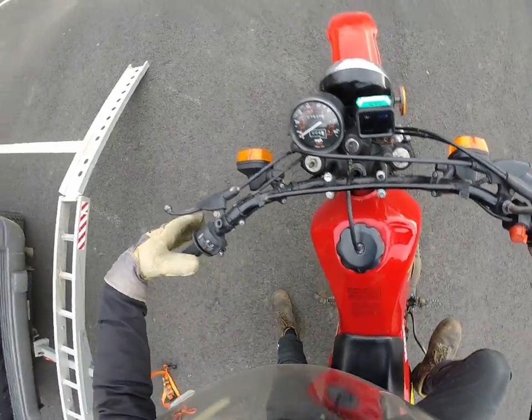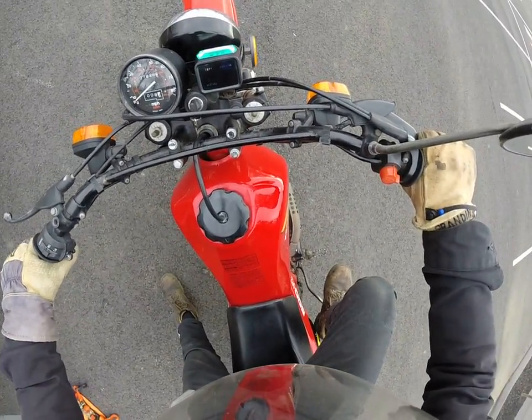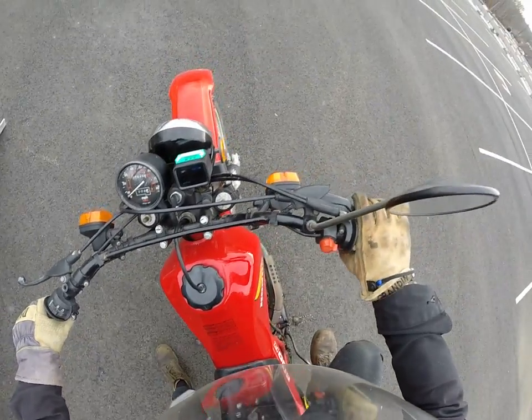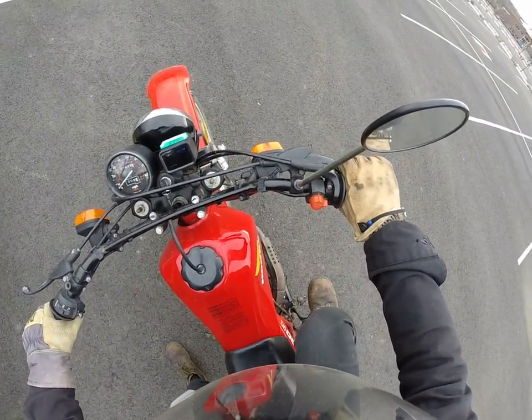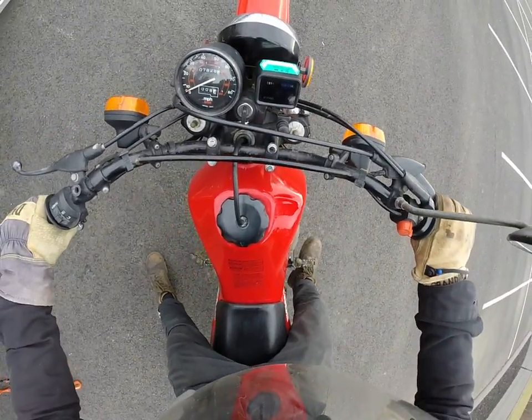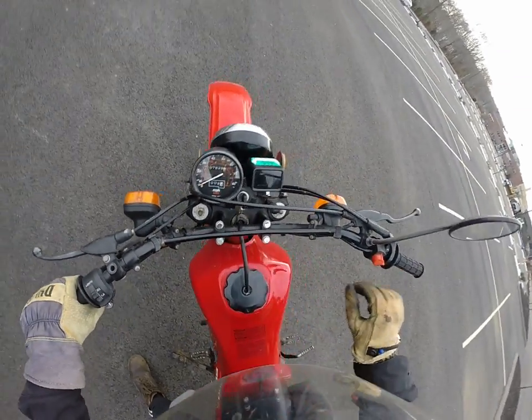I like to grab my front brake, leave the clutch out, push to the hard spot, use the decompression lever right under here — just bump it a teeny bit past — and then do a nice smooth stroke all the way through, not a big heavy kick. There you are, didn't even use any choke.